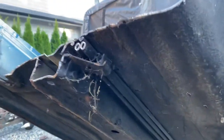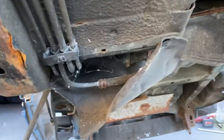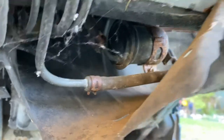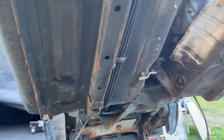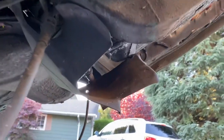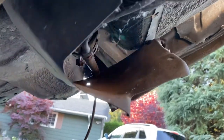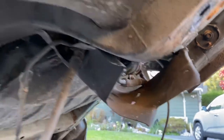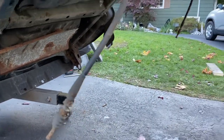Those are the fuel lines — of course they got cut. That's your fuel filter right in there, in case you're wondering where the fuel filter is. It's on the passenger side, or on the right side, and there's a little plastic cover plate here, and then the fuel filter's right in there.